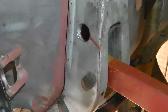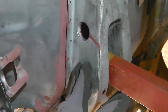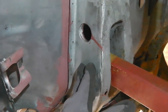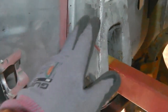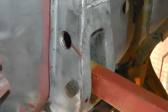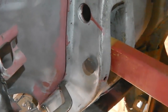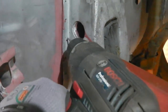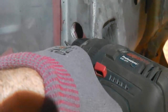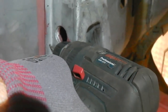Okay, we're under the chassis and we're looking at now getting the exact spot weld position holes drilled. Sorry, plug weld position holes drilled, because this is a new floor. It hasn't got any holes for us to connect to the chassis leg. So this is where the great idea of drilling straight through when we did the spot weld removal comes into play, because you now take advantage of the fact that this has got holes in it and you can drill straight. Okay, I'm touching the edge of the chassis with the chuck of the drill, but don't worry, it'll still go through.